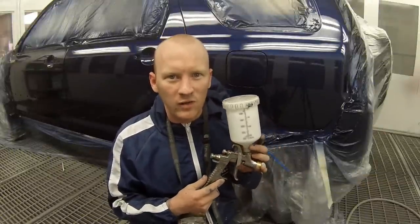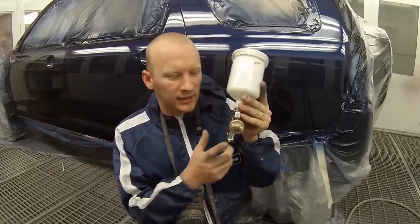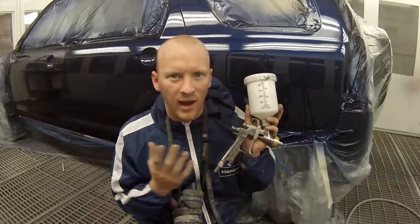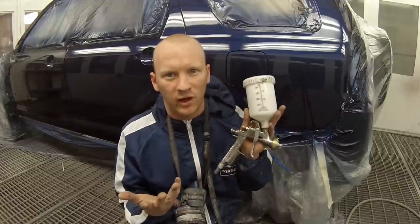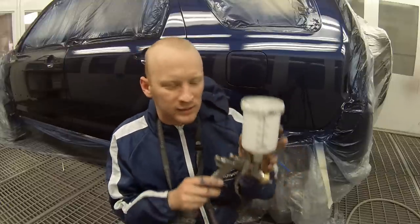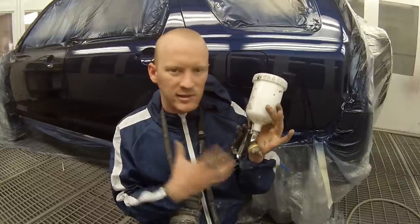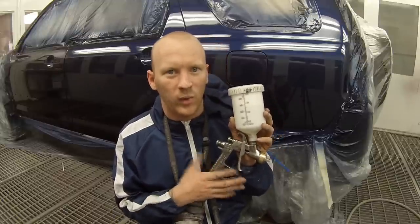So as you can see I've put my first coat of clear on using the Anest Iwata W400 with the WBX tip. That actually stands for water-based tip, but you can still use it with 2K clears. These are a very popular gun — my paint supplier said it's their second most popular behind the GTI Pro. They're cost-effective, around $500 here in Australia. They get a lot of paint on and a good finish. Best setup I've found: have the fluid wound right out, open the fan right up, and set the pressure at about 2 bar. It's not HVLP so there's more overspray and it goes through a bit more paint, but you can still get a nice finish.